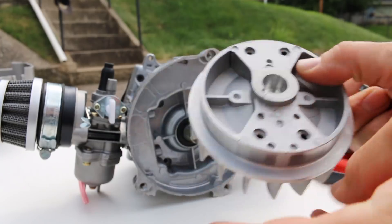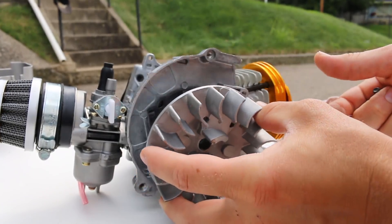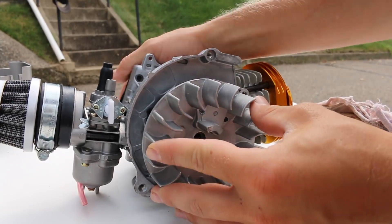When I actually get the engine in something, I'm going to try the different options — turning it to the right for advancing timing or even trying the stock key — because every engine is different. Our engine is going to be pretty heavily modified, so it'll be unique. There are only a couple of videos showing this key install and they've been on mostly stock engines. A few people say the stock key works best, but we'll see what works for our setup. Let me know in the comments if you've done this install before. Now find the key slot in the flywheel and line it up with the rocket key to begin reinstalling.